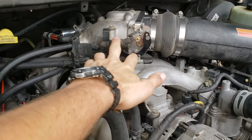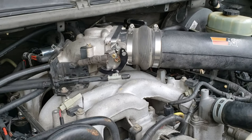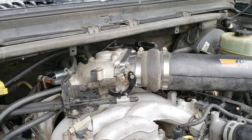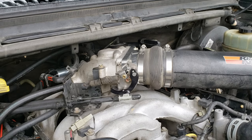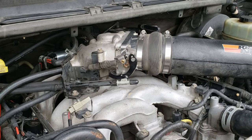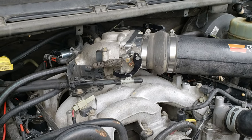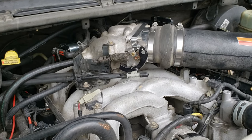The first thing you can see is I've stretched out some of the coils in the middle of the return spring here. The return spring that comes with the AccuFab is either overpowered compared to the stock spring, or maybe my original one was just worn out. I found that driving on the road, my foot actually got cramped up, my cruise control was having some problems, so I was having to use my foot the whole way — it was really difficult to keep that pedal pushed down. So I stretched the spring out just a hair.